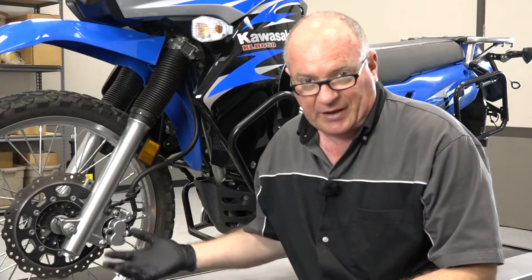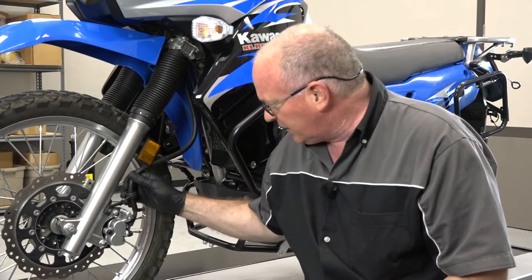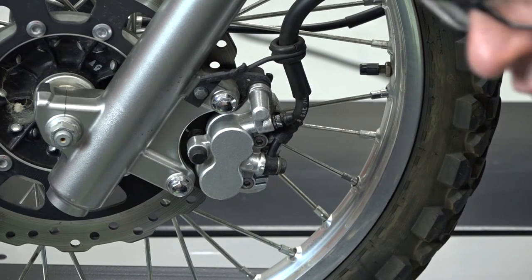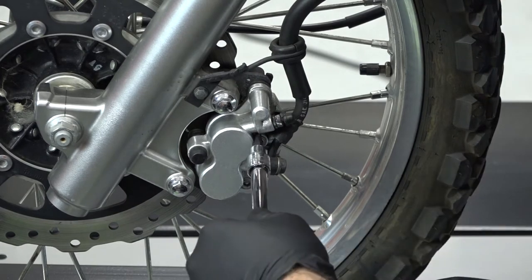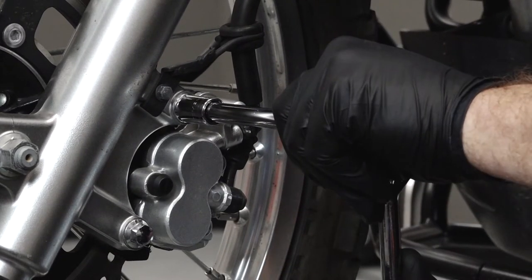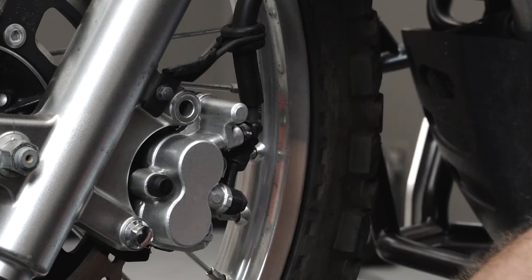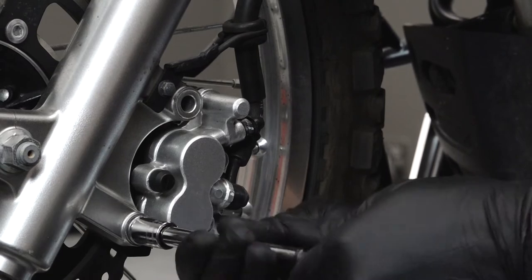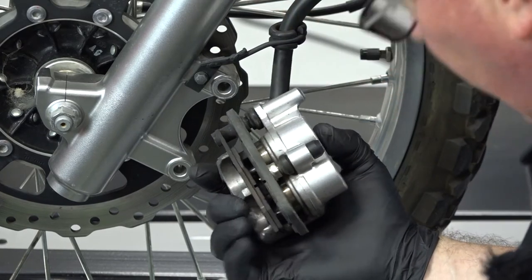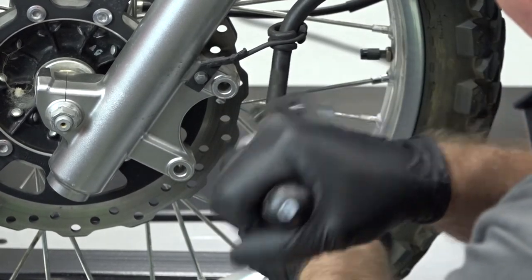Alright, let's get the front set done. It's actually almost a repeat of the rear. This one I think we can leave the bracket in place that's holding the actual brake line. So let's go ahead and at least break loose those two 5mm pins that are going through the brake shoe. Now I would expect that these probably have about the same wear as the rear, which is almost zero, but you would inspect them the same way. Because most people wear out their rear shoes before they wear out the fronts.